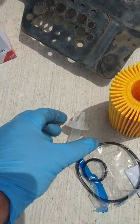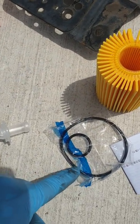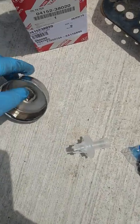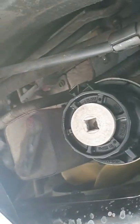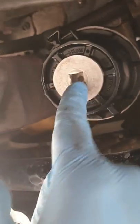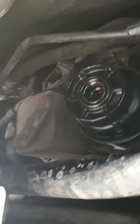This is the original Toyota oil filter opened up. That's your drain plug and I'll show you how to use it. Your oil filter is internal and comes with new seals — these must be lubricated with used oil before you reinstall them. That's the key for the oil filter — get it from Toyota, it's original, about $50. Make sure you have it otherwise you can't remove the filter. You need the half-inch drive to unscrew the base plate first, then insert the little drain tap so oil drains out before you unscrew the filter housing — otherwise oil will go everywhere.